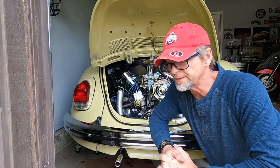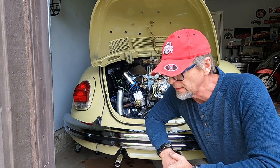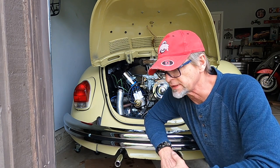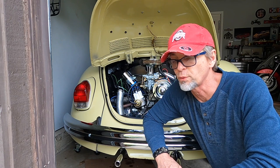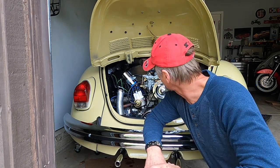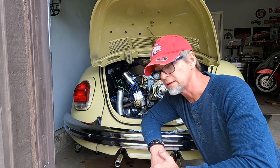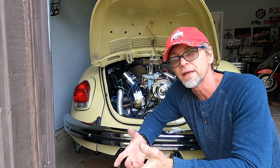Okay, so I couldn't find the carburetor studs in our local auto parts stores. I did find a possible solution I may contemplate here in a few days, which is I have a couple of M8 1.25 bolts that are machine bolts, so I may be able to rethread the part of the bolt that is not threaded, and I may be able to make the stud that I need for the carburetor. Meanwhile, I was able to install it with the actual studs that the carburetor has, but I'm really shy, maybe a thread away from having a full thread come out. And in terms of a mechanical application, that's not ideal.